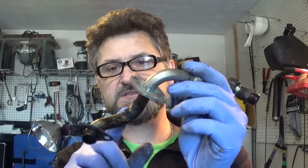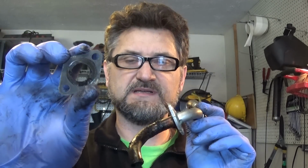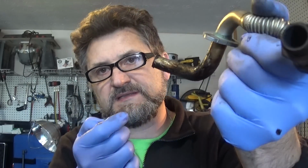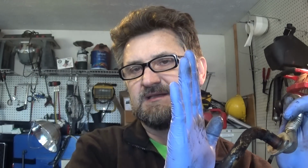And this tube is a little tricky as well, and I'm pretty sure it's going to be tricky to put it back in because of this curve here. Also you will have this gasket as well. You just have to kind of play with it and move it around until it gets out. I got no good explanation how to do it. You just have to curse a little bit and say a couple of nice words about it, and it will get out. There's plenty of room between engine and firewall to pull this off.